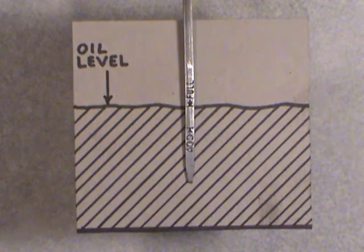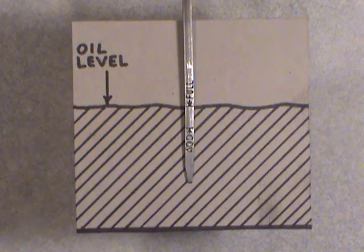So give it time, if you can. Say you're doing some highway driving, for instance, you're going for a couple hundred, couple thousand mile holiday, and you're stopping in for gas. Don't be in any hurry to check your oil, because like I say, that oil is suspended in the top end of your engine. It'll give you a false indication of how much oil is really in there.